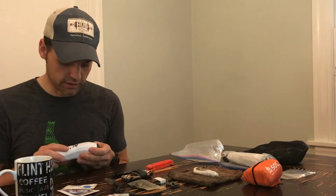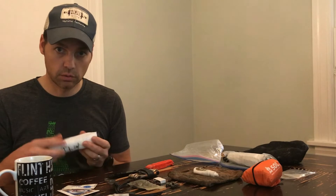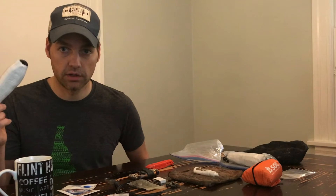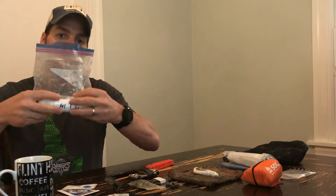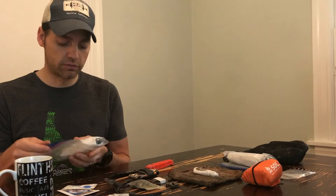The other thing I've learned on these off-road races is with all the vibrations of riding off-road and different parts and pieces being next to one another, it's really easy for a tube to get a friction hole worn into it. So one thing I always do with tubes is wrap them in electrical tape, and then also throw them in a plastic bag, just to help offset some of those friction holes.